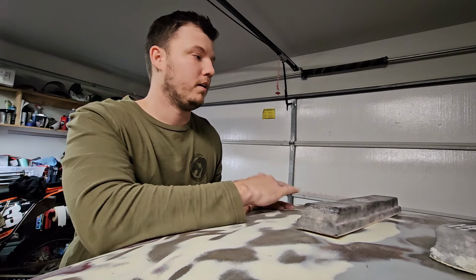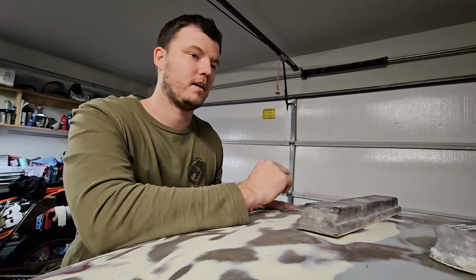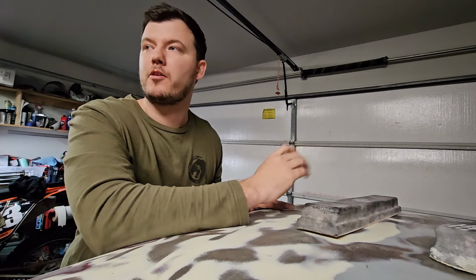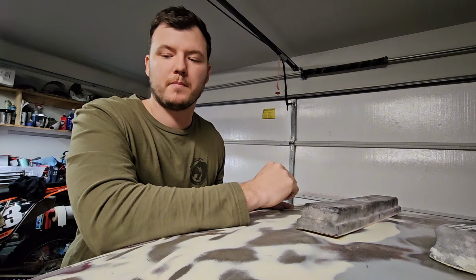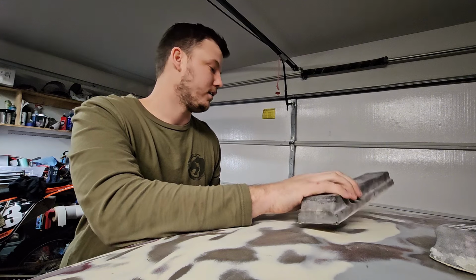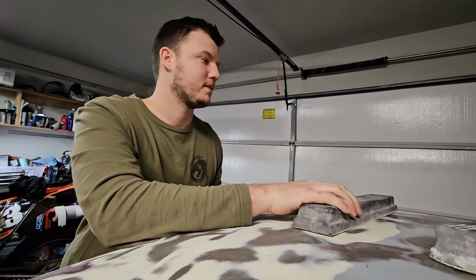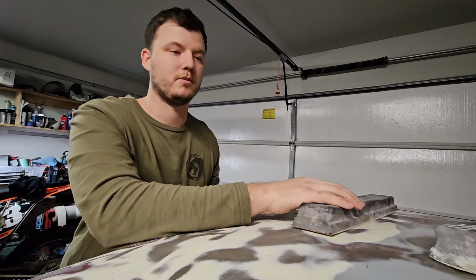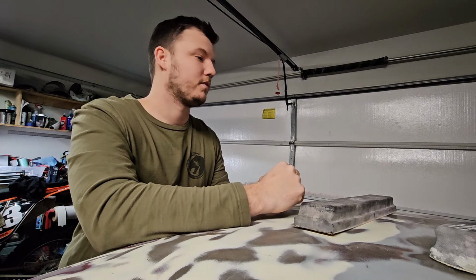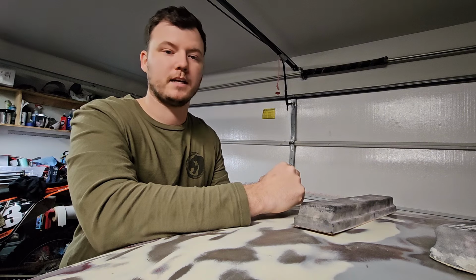But I'm going to block the whole roof real quick, and then I'll lay down some primer, and after that, let the primer dry, and I'm gonna do some guide coat, and then we're gonna reblock it, and all of the low spots will be real nice and black, and that's where I know I need to either do metalwork underneath or do some Bondo or some body filler of some sort. So yeah, one step at a time.